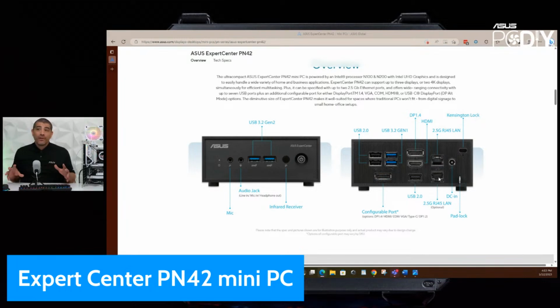Pair this up with one of our 2.5 gigabit routers, right? On the LAN side, run that in, and then run one of these others to your system that also has 2.5 gigabit LAN. And now you've got a really cool, performant external enclosure that can serve data across your network, right? Very, very cool. And again, you also have high-speed Wi-Fi 6 built into this unit too. So you can also have high-speed wireless connectivity and modern Bluetooth connectivity with Bluetooth 5.